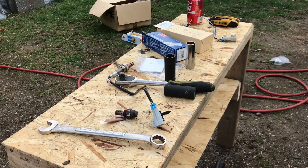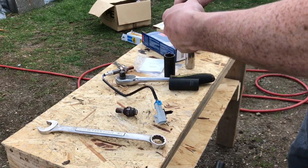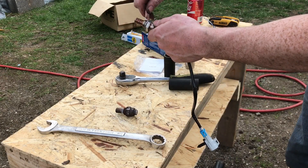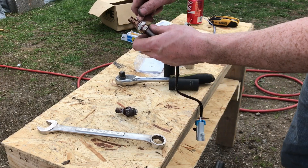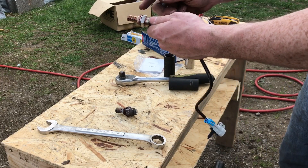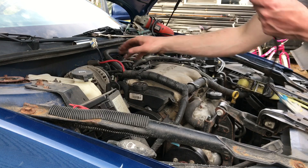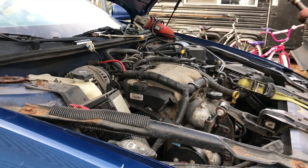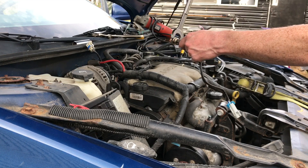We're gonna install the new one. I'm gonna use some of this anti-seize — hopefully if I ever have to do this job again it won't be so tight. All you're doing is lubricating the thread. The reason for this is it gets so hot down there; you would hate for this to be seized and rust-welded to where you can't even get it off. This is gonna be your wiring harness right here — it clips into this piece. I just want to go ahead and get it in there.